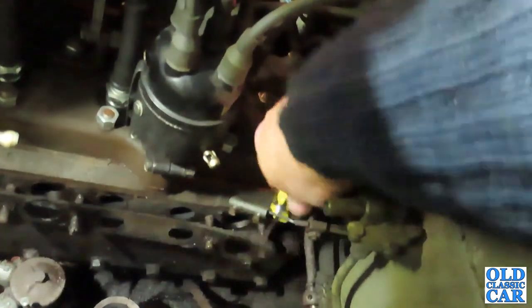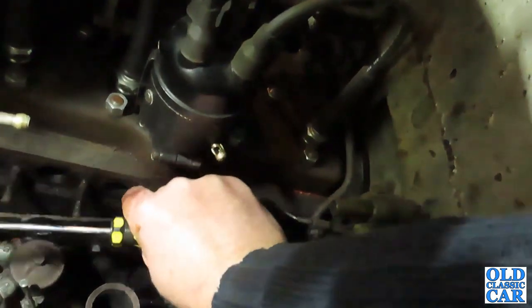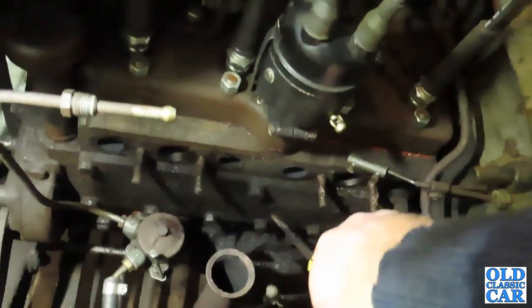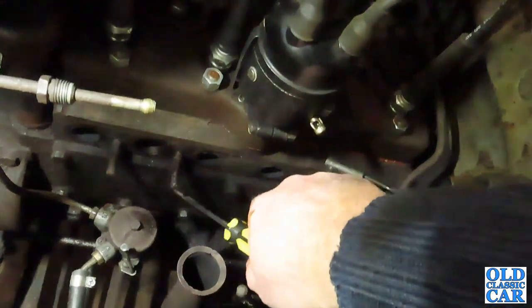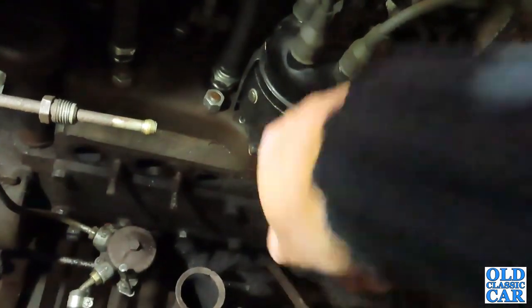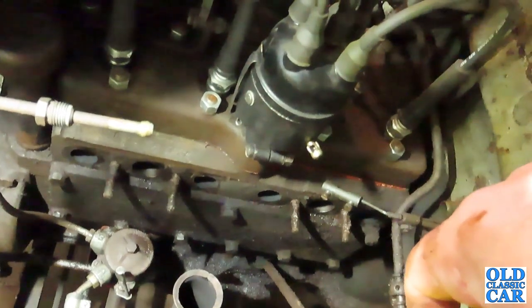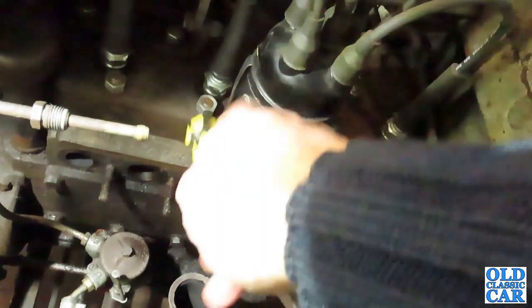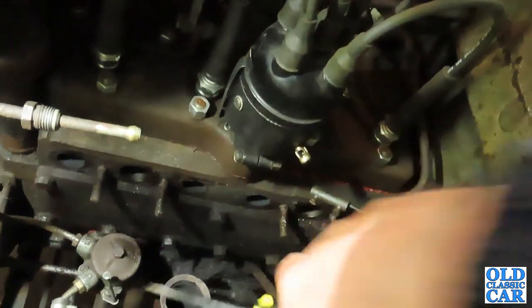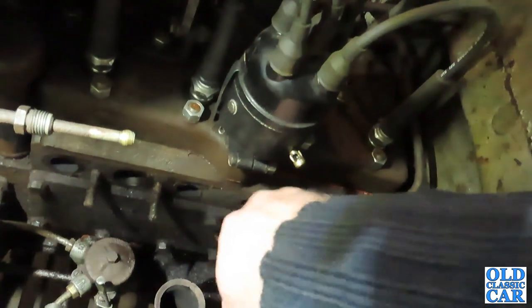I may also whip off the valve cover that I was talking about in the previous video, where I was talking a little bit about side valve engines, and I said that to work on the valves, to adjust them certainly, you have to remove the side cover off the side of the engine. And there it is on the Ford engine, the E93A engine, there is the side cover, and that is what you take off if you want to do any work on the valves. Obviously that's the cylinder head, you have to take that off if you want to remove the valves completely, but you can do a fair bit just through the side here.